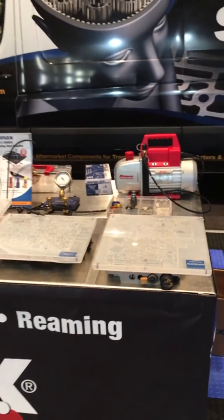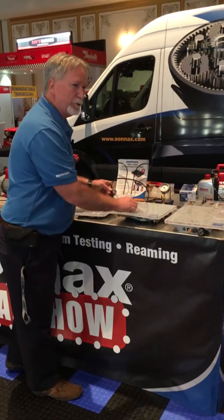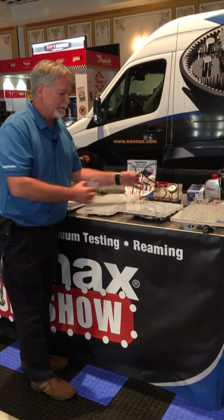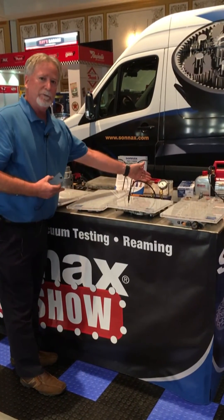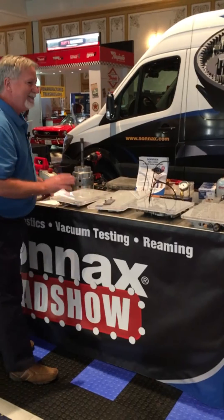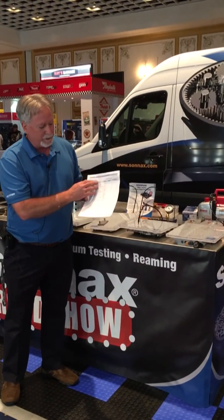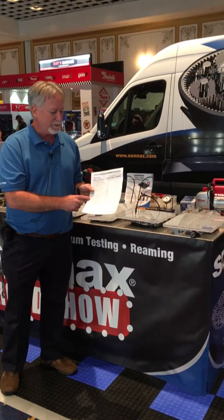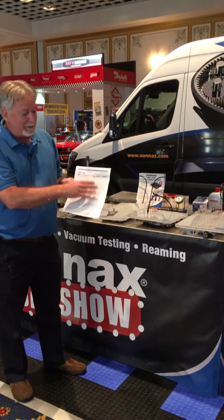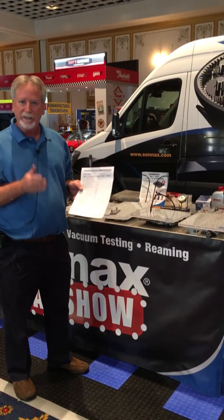What's nice on these plates is it fits over the entire valve body, so I don't have to move from bore to bore to bore to do the test. Once I put the plate on there, I just put the pin in — it's going to give me a number. And based on that number, the nice thing is along with it comes these worksheets. The worksheets list out the names of the valves and the orifice that we're actually going to test, and it gives us these columns that help us document every test that we do.